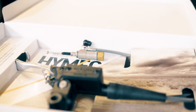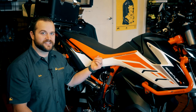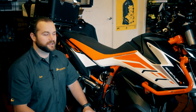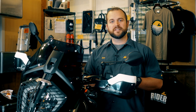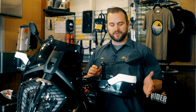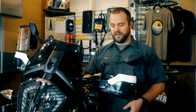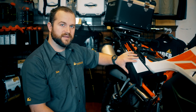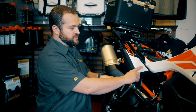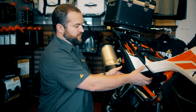To install this hydraulic clutch kit we need to remove the gas tank from the bike. I'm going to start by taking the seat off and pulling off the crash bars — I won't show those steps as they're pretty straightforward. To give ourselves more room to work, I'm also going to remove the clutch lever side hand guard, take the mirror off the perch, and then remove the two side panels. These aren't held on with any fasteners, just two little press-in rubber grommets, and then they slide forward.